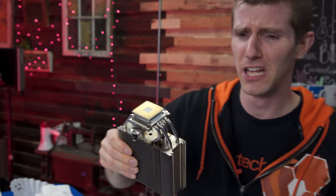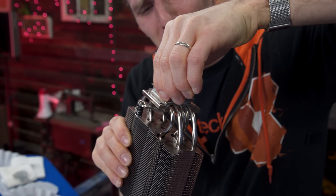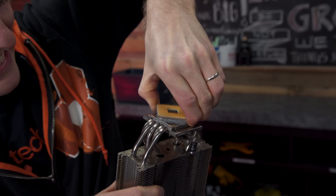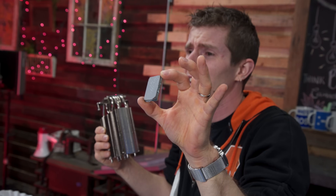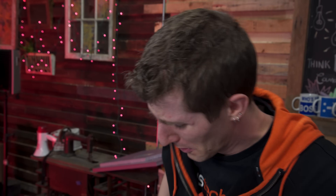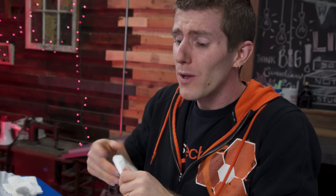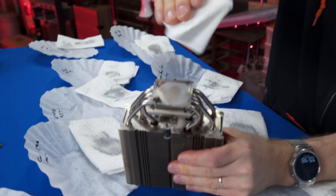So the obvious question is: what could possibly go wrong while removing a thin compound like MX4? Let me show you — you can pull the CPU out of the socket when you go to lift the heat sink off. I had just done another mount and... oh. Oh. What is that? Ryzen 1800X — oh, terrible. Anyway, the point is I had done a final mount so I could do a live demo. What we've discovered is that some household agents would work to remove thermal compound, but another perfectly viable method in a pinch is straight-up elbow grease.